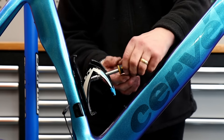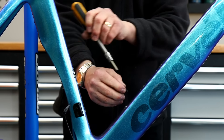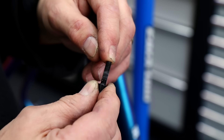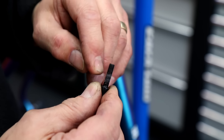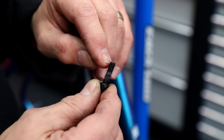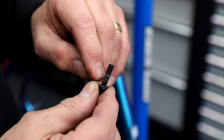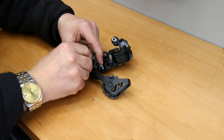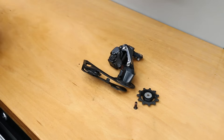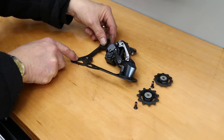We're even going to take the bottle cages off here. The bolts that were in there had begun to show slight corrosion - you can see the black head and in the middle there's that little silvery section which is actually early corrosion on that bolt. These bolts weren't greased or lubricated. We're going to grease and lubricate them which should stop that catalyst of water going in there causing corrosion, so we'll make sure that when we put those back together they're all lubricated.